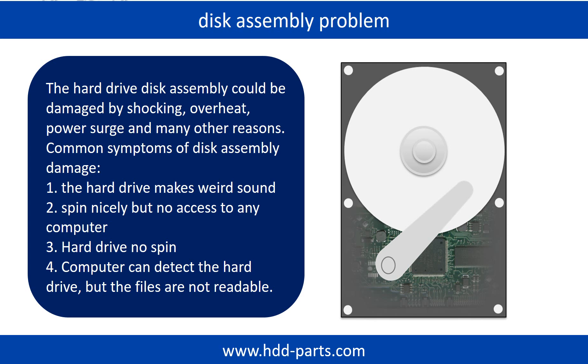Tip: if the storage is configured as mirrored hard drives, you can take the bad hard drive out, then put a same size or bigger hard drive into the bay, and the storage will mirror the data to the new hard drive automatically. If this trick doesn't work, that means the two mirrored hard drives are both damaged, or the storage was configured as RAID 0, meaning the two hard drives work differently.